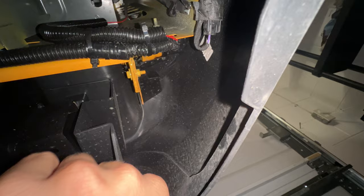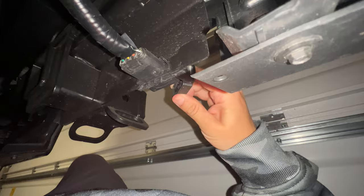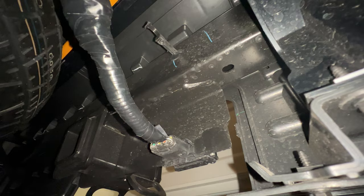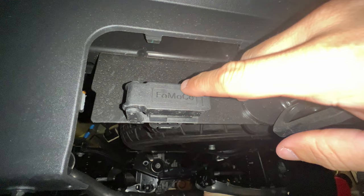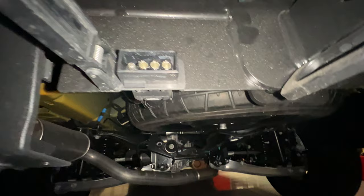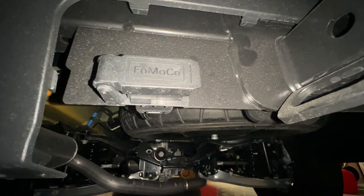The reason why I wanted to do this is because I wanted to make the connection on this side and not show that I'm actually using something on the other side to plug it in — so I wanted to do a clean install from the back. That way no one can see it and it doesn't look awkward. Also, just in case I want to haul something, I can actually open this and still use the four-pin connector here so I can haul a trailer. I can still use it by plugging it in, and that thing isn't taking up the space right here. So that's the main reason why I did a hard wire in.